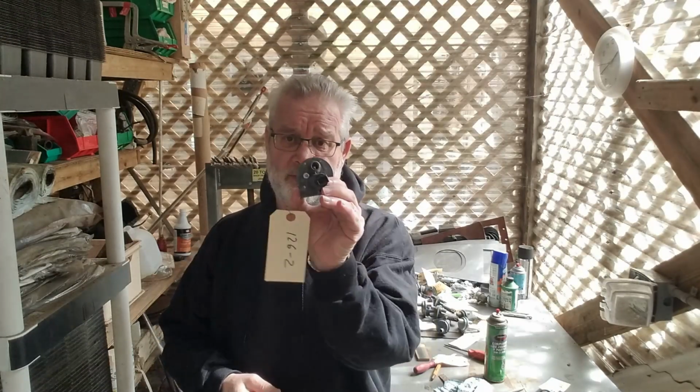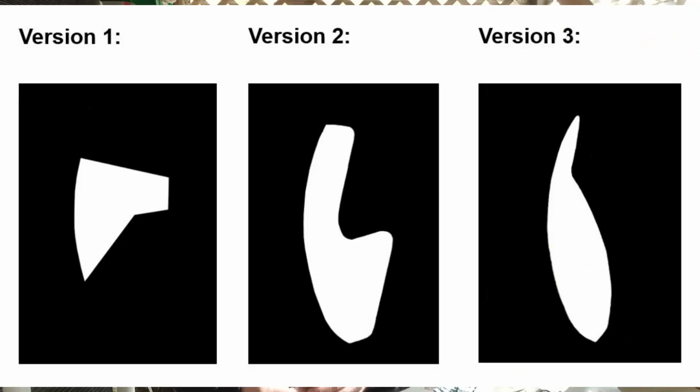The next thing you do is look through the assembled piece for the air gap at room temperature. I'm going to show you the typical air gaps that I see in the video. Here you can see for all three types the air gap that you should see at room temperature. This is based, in versions 1 and 3, on looking at new old stock units, and both are basically open 30 degrees from fully closed. I cannot say the same thing about version 2 because I don't have one here, neither used nor new old stock, but I assume with all the mechanics inside being the same that they too should be 30 degrees from fully closed, and that's what you see here in the middle. So if you look through the auxiliary air valve in fully assembled state, you should see these gaps. If you don't, then you need to work on it.